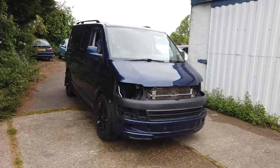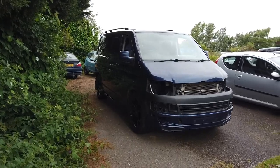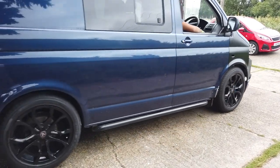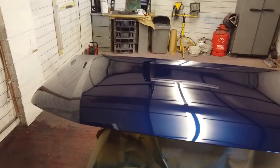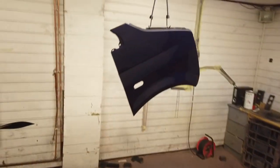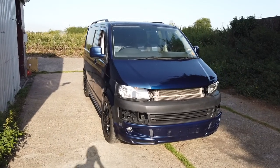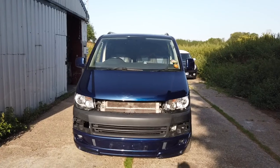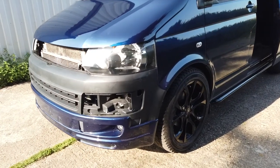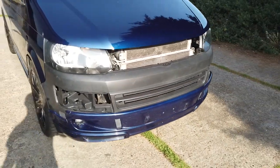With the new wing and bumper fitted, she's really beginning to take shape. The next job was to spray the bonnet and the wing. Here we see it with the new bonnet and headlights fitted. The headlights bolt straight on; however, the wiring is slightly different to the pre-facelift headlights, so you would either need to rearrange the wiring at the connector, or you can purchase pre-wired connectors which fit your original wiring loom and go straight into the back of your headlights. These can be purchased off eBay — I just rewired mine.